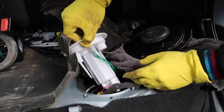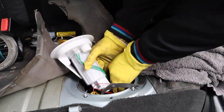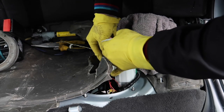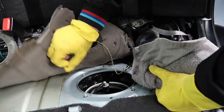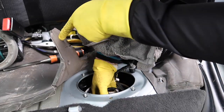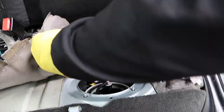Put some gloves on — some yellow gloves. You want to be very careful with all the connectors in here because there are level sensors in here as well. Get to the pipes and make sure your tank is empty as well. Now that's out — as you'll see, if you look down here you'll have a load of fixings from the other fuel pump: the main one right here which will come up, and you've got this little piece right here which has to come up as well. That one clips on — just be aware of that.